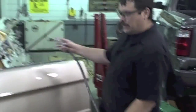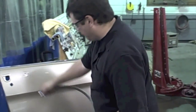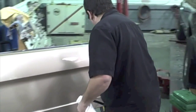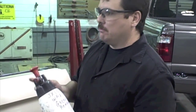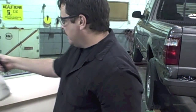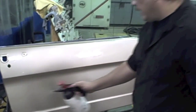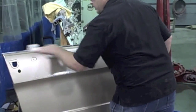We've got it rinsed off. We're going to go ahead and blow it off. Then, to make sure we have all the wax and greases off, we're going to use some wax and grease remover. There are a lot of different manufacturers that make this, but it's basically designed to take the wax and greases off. You can get this in aerosol cans. Spray it on there and then just wipe it off really good.